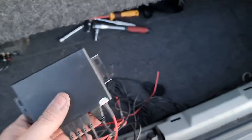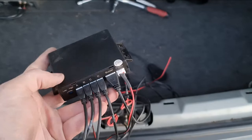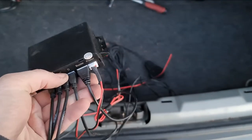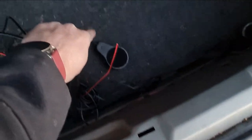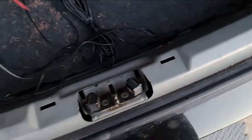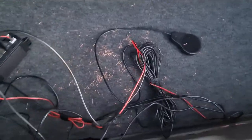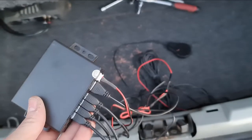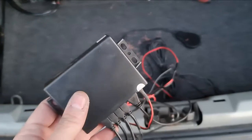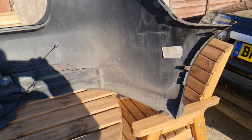I've been having a look at the reverse sensor box and as it happens all it has is the entry points for the four sensors - A, B, C and D - a buzzer, which is this little speaker, and a power wire, which has absolutely no data connection to the car at all. So it's an aftermarket unit. That makes things quite easy for me because all I need to do is power the unit; I don't need to program it with the Tech 2.